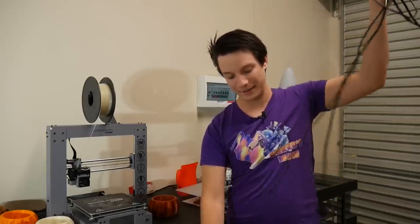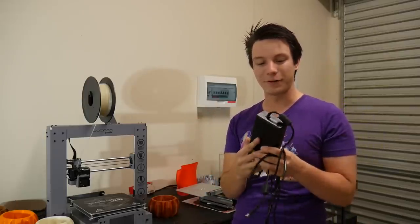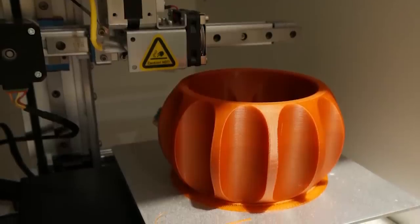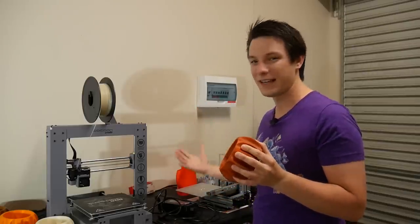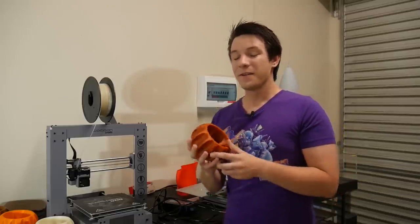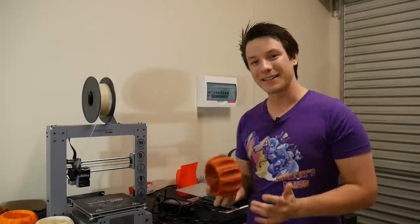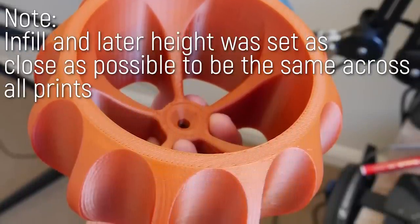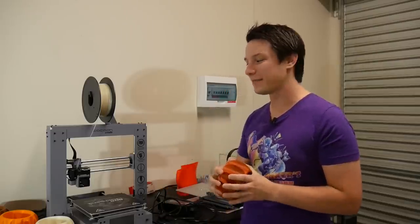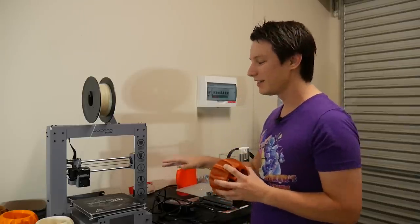I'm not sure this is the original brick the Cetus came with — it's a 19-volt brick that might have been for a larger printer with a heat bed. It definitely doesn't need this much amperage to run. The print from the Cetus was one of the nicest in the lineup and only took 10 hours, since the Cetus software runs on fine settings. What's really interesting is the Cetus print only took 0.5 kilowatt hours of electricity — much lower than the 2.7 that ABS took. The heat bed is really the killer for energy consumption, not the motors.